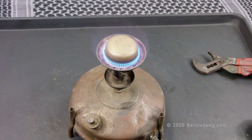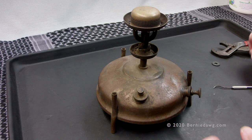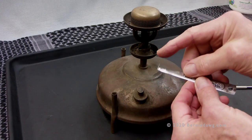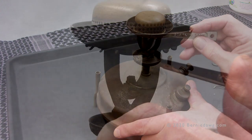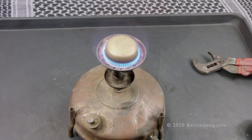There's a popular video on how to start up the stove — you'll see a link to it in the upper right corner of the screen. If your stove doesn't burn well when you start it up, it may need to be pricked. Yellow flames or poor quality flames indicate the jet may be clogged, which is not surprising for an old stove. Use a jet pricker — a small wire that fits inside the hole of the jet — and insert the pricker into the jet opening, wiggle it around, and that will clean the jet. You may need to burn through half a tank or even a full tank before your stove burns well, so don't be impatient.